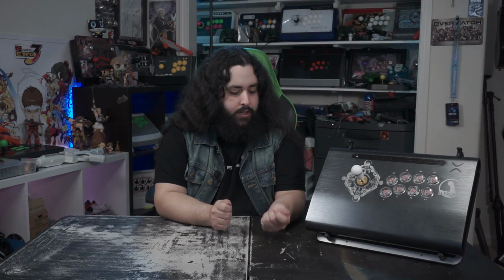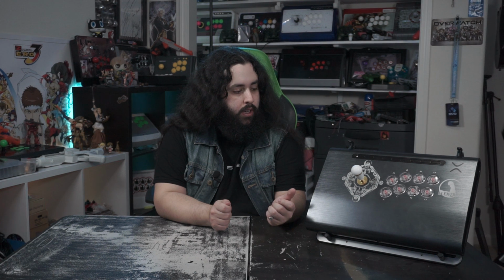Yeah, so I had to do that, and it was a pain in the ass to get this to work. The other thing is that it's very hard to plug in the actual ground and hot, because these things don't really like to click into the quick disconnects that are on your 5-pin JLF harness. It's very weird because some of them will click in, and then others will slide right out. I had a couple of times where I had to open this up and reattach them because they had come loose and weren't activating anymore.